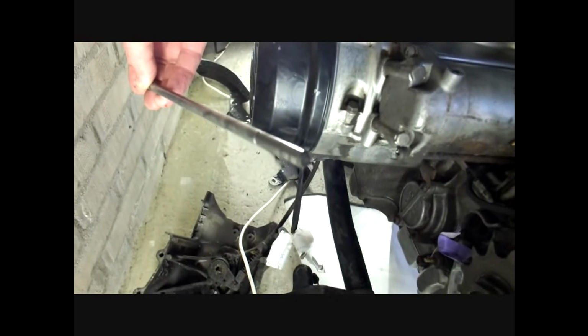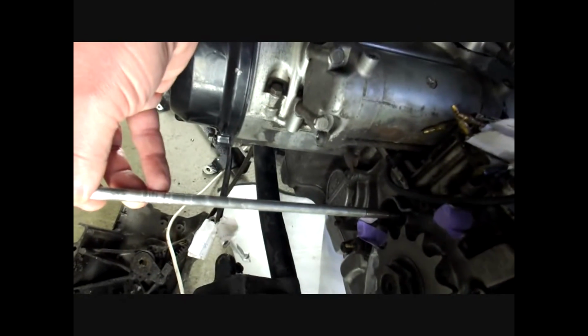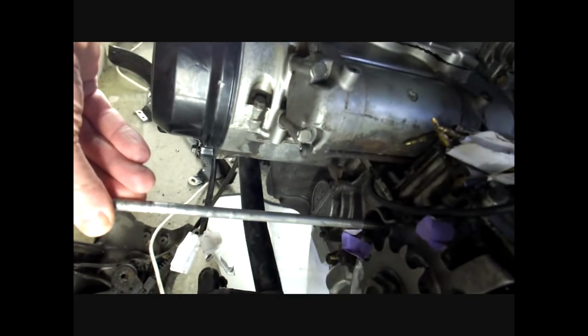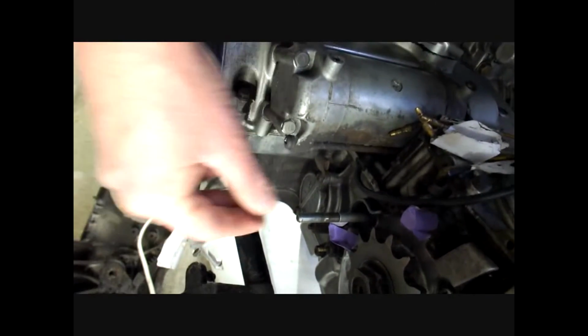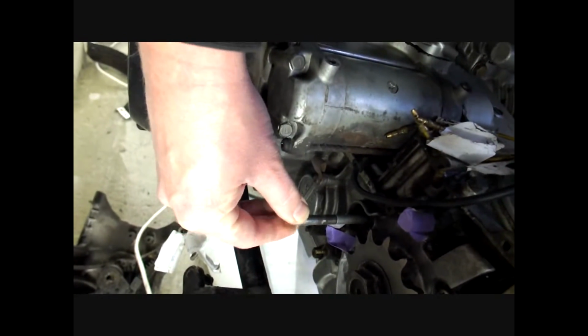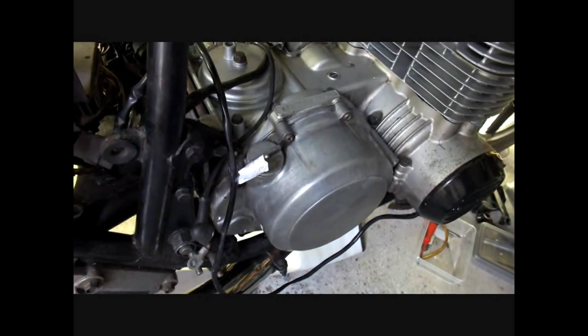Now, I've been reading a lot on the internet, and some people actually turn the pushrod around. So that's also what I'm going to try, so I don't have the damaged area to that extent on the outer side of the engine. So I'll try that in a little bit. I'll push the pushrod in the other way around. So there she goes back in. It does fit quite snug eventually when you put it all in, so that looks okay. And the pushrod actually goes all the way through to your engine and comes over to your clutch, and it frees your clutch so you can change gears.